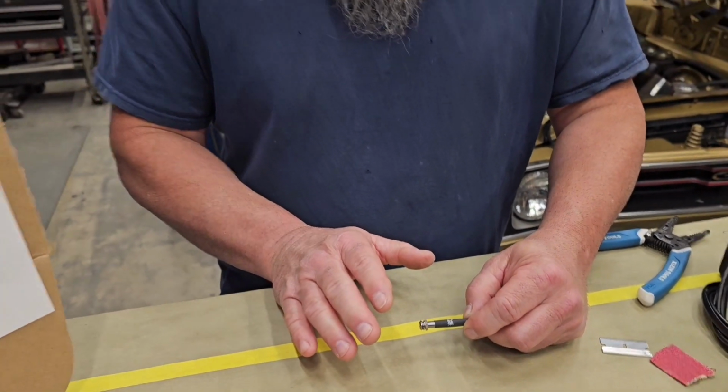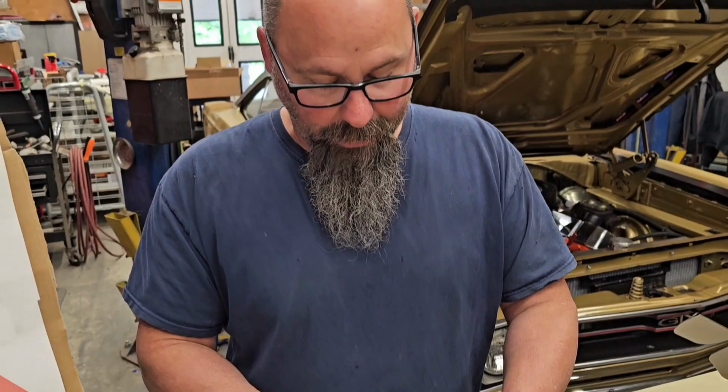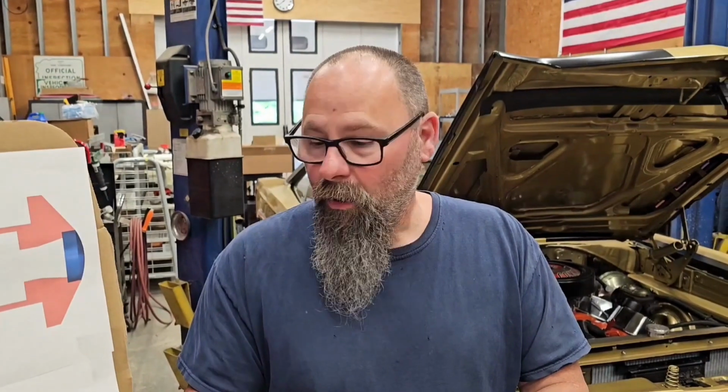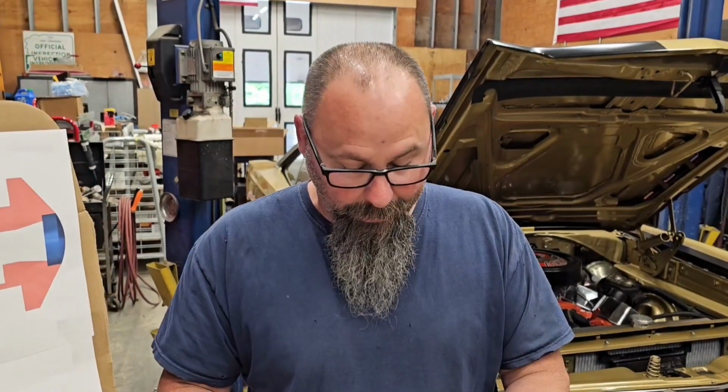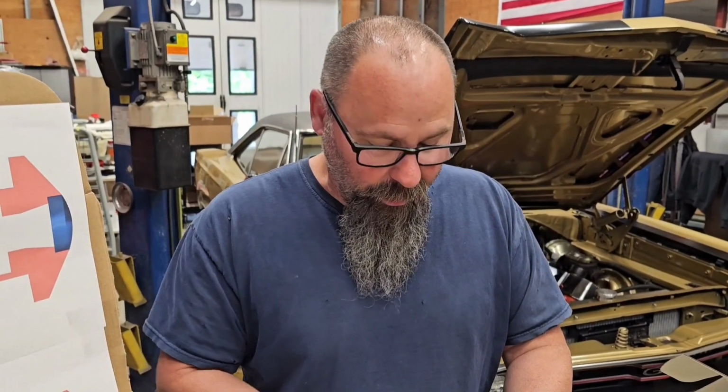Now, we tried many different ways of securing the fiber into the housing. One of the ways we tried was epoxy. We don't recommend it because sometimes pushing it in, we get a little bit of epoxy on the end of the end glow and it just distorts the light. So we opted to use 3/16 adhesive back heat shrink. Plus, there's serviceability as well. If you epoxy it in, you can't pull it apart. And if you cut the fiber, now you just destroyed the housing because you can't reuse the housing.